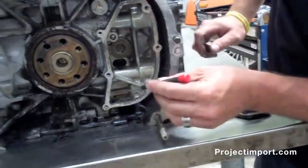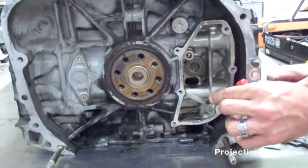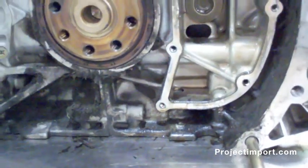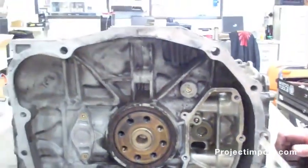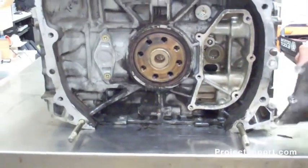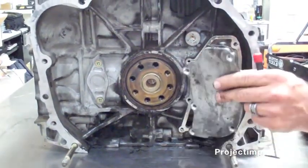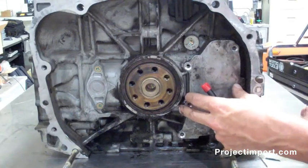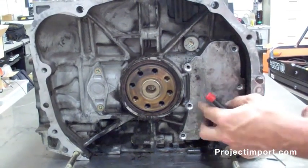You'll notice here there's a drain. This drain drains back to the oil pan, so if any oil gets cavitated up into the actual crankcase ventilation in particles or molecules, it should hit these windage trays and go back down into the oil pan. Kind of a self-reliant catch can in the back of the block.